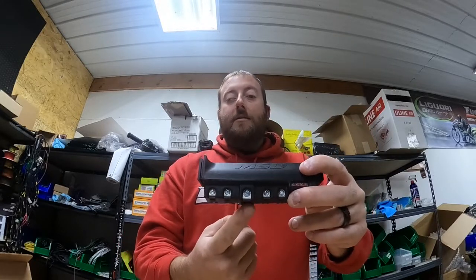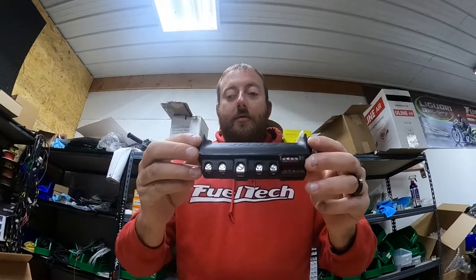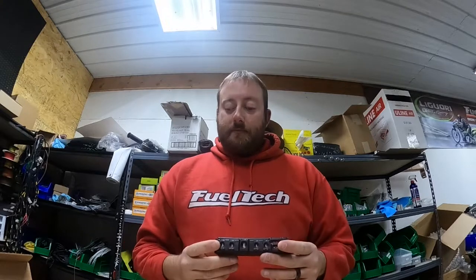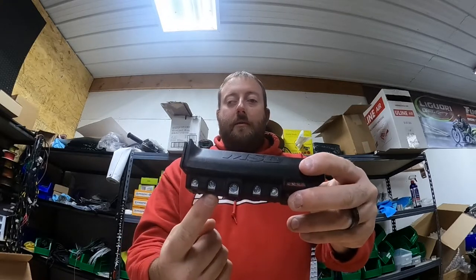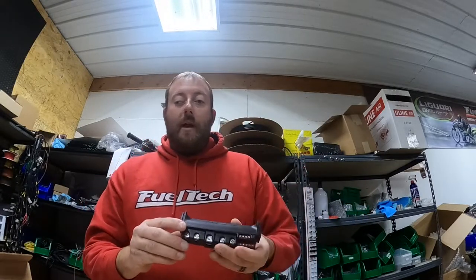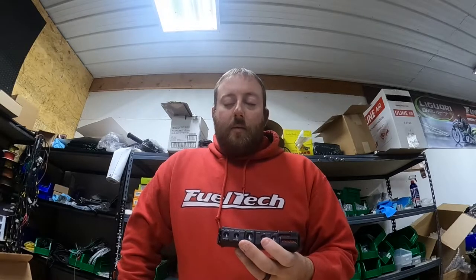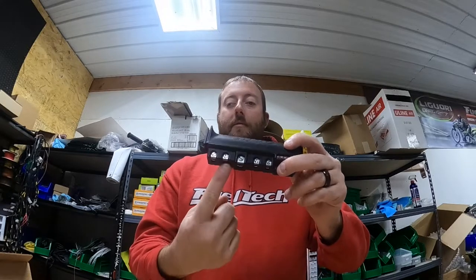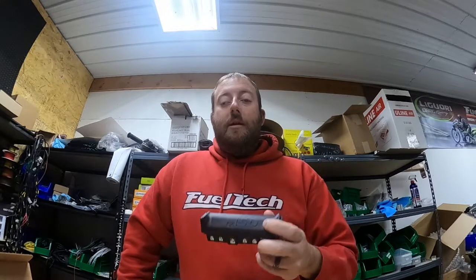This battery terminal here — you connect that to your 12 volts, connect it directly to your battery. I usually use about an 8-gauge welding wire, something like that, maybe 10-gauge. You want something pretty heavy going in there. Each of your four outputs on these medium-sized lugs are 12-volt outputs, so when you connect a fuel pump to it you're going to run a wire from your MSD relay out to your fuel pump.